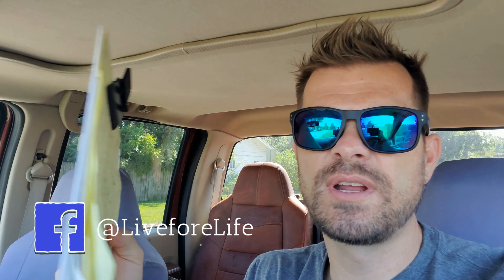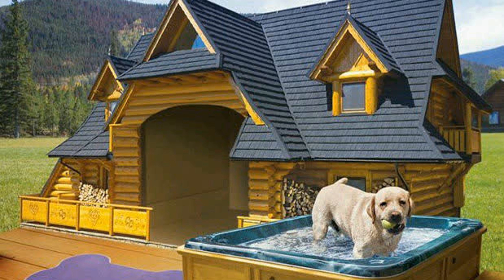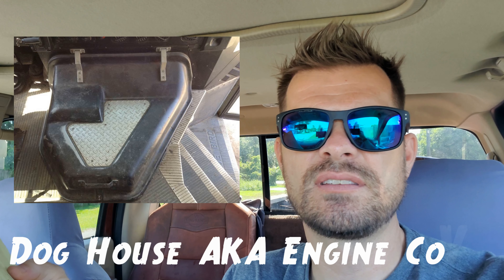Some of the exterior running lights — when we were framing I had to cut some of those wires, so I just have to redo them. We framed around the front wheel well in this video, which was awesome — got that one knocked out. I'm also going to frame around the rear lights for an access panel using some two-by-threes, so I've got access to those lights later. I won't spray foam that area — I'll probably use some wool insulation back there so I can always get to those wires.